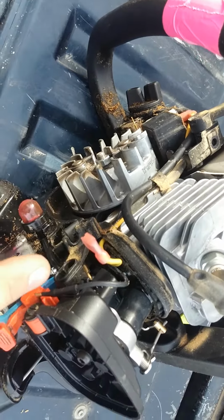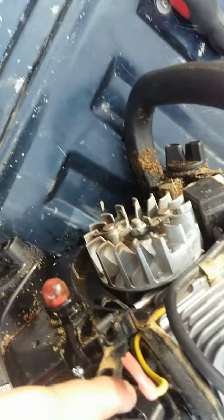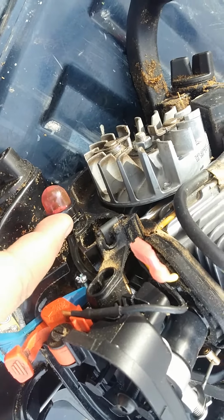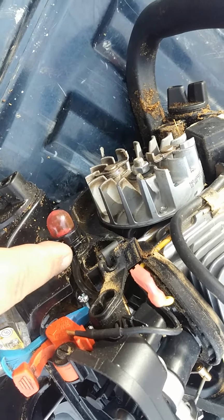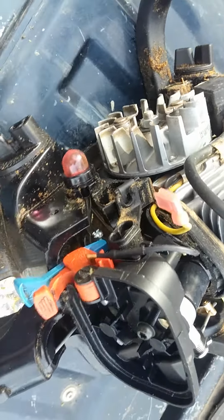put this switch back where it's supposed to go, just plug it right back up, you can see it, right there. This new primer bulb, a spring popped in there. I just took a screwdriver and pried it, and it popped out. Disconnected the fuel line, and the top clear line right above my fingernail was the new line, which went right up.